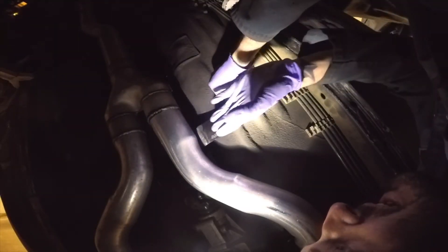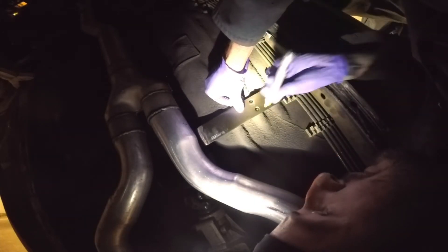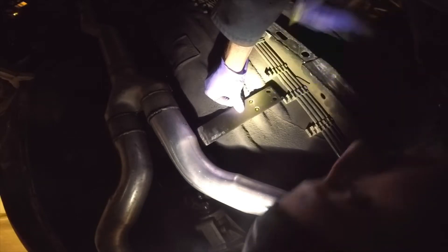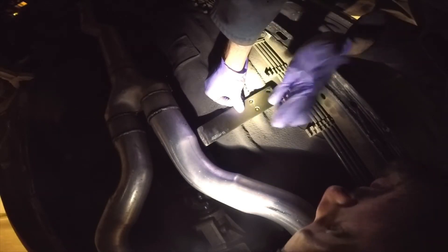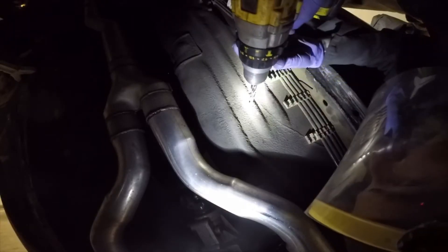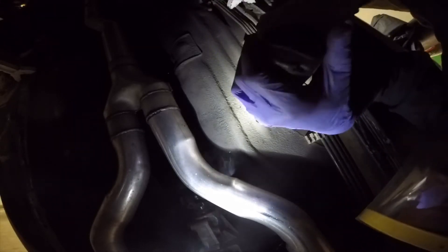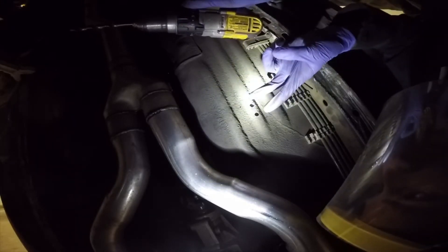This side fits up there quite nicely — there's just enough room to get the drive shaft on and off, and a little bit of room over here. We're going to take our paint pen and mark where we need the two holes to go through the body, right about here, which from the top side looks like it's right underneath the seat — no problems hitting anything. We drill the holes a little bigger than the bolt size so we have play left-to-right for adjustment.